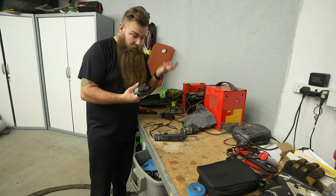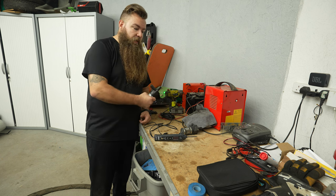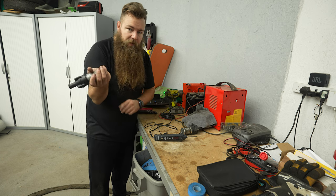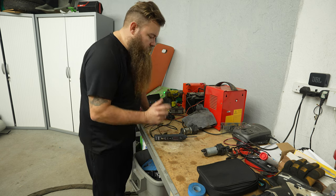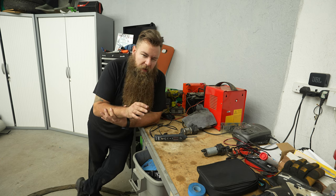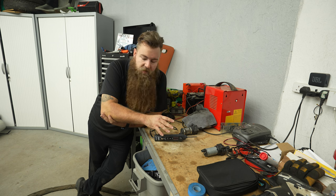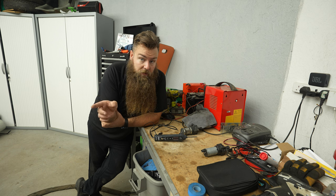Without a working pump, your car isn't getting the water flow it was designed to have. You could crack your manifold and have heating issues — because this runs really, really hot with a hybrid turbo, bigger turbo. The manifold gets hot. I actually noticed this because when I got out after a drive and turned the car off, I could hear it going ting, ting, ting — you know when metal gets really hot. I put my hand on the pump and felt nothing, and I thought, that'll be great to show everyone.